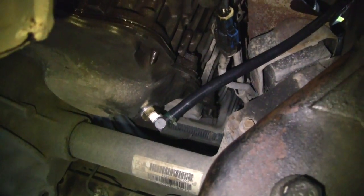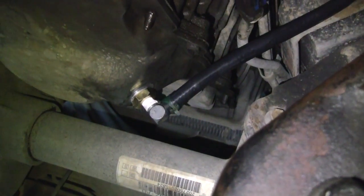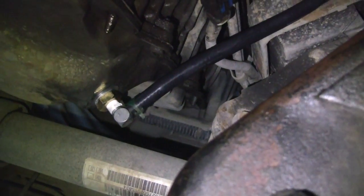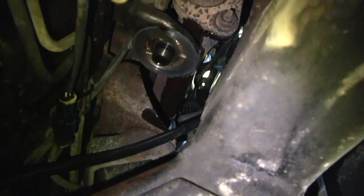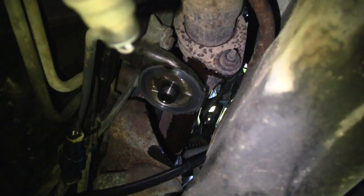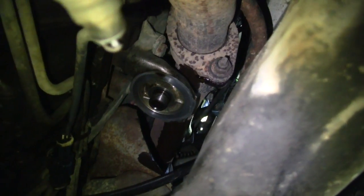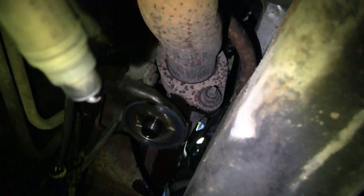Phase one is complete. Got the oil line — the feed line for the pump — all hooked up and I'm pretty happy with the way it came out. Nice clean setup, not a whole bunch of fittings and crazy stuff going on. The plan for oil changes is simply to pull that clamp off, pull the hose off, rotate the thing around 90 degrees and let it drain out. Next phase is to put the sandwich adapter on — I already dropped the oil filter off — so now we're going to get that mocked up, figure out the best position for the hose fittings, and bolt it up.